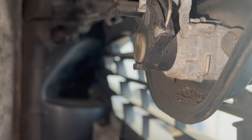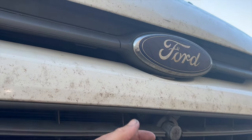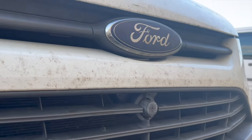I'll just set the camera up now to show you that. Pulling it in the downward position does the first part of the bonnet release. You can put the pry bar in to pop it the other way for the second part, but once you've done the first part of the release it's really easy after that.